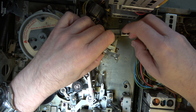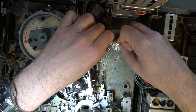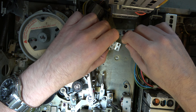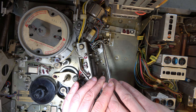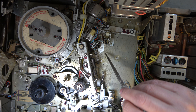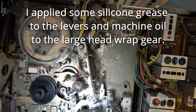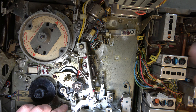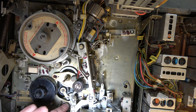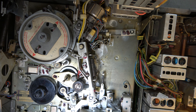I believe this switch should be activated and it's not. I'm going to take it off and have a look at it. The switch itself is working fine - it's that the actuator has not been controlled properly. I've found these switches themselves to be quite reliable, so something's not pushing on it when it should be. This lever here is not going far enough - it appears it's not quite reaching that point on the unlace. Probably part of this mechanism is slightly jamming and not allowing that slider to go all the way. Let's lubricate this part of the mechanism then.